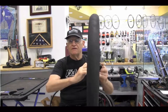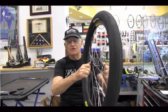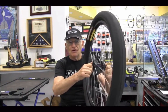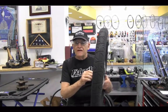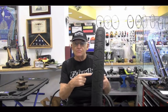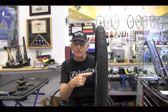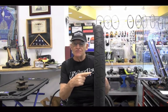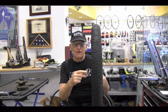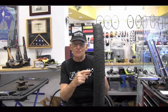If I spin this wheel, it spins very well and would be phenomenally strong on a bicycle. The problem is, I have to figure out a way to attach this wheel to a car. I also have to figure out a way to have a stronger axle — this hub is obviously made to go on a bicycle, so I have a 9mm hole going through the center of the axle. 9mm is not nearly enough to support the weight of a car, so I have to figure out a way to remove this axle and replace it with a stronger one.